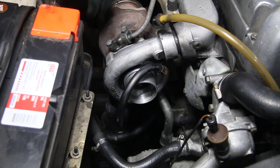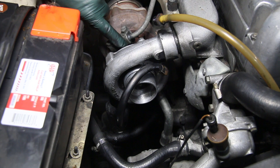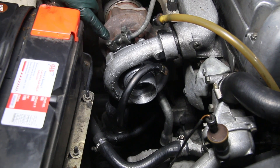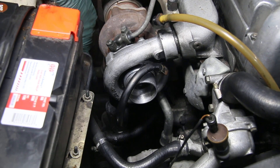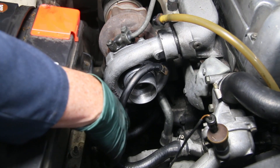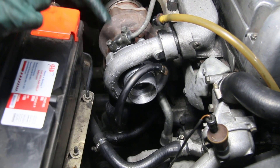Anytime you remove the air filter housing and intake elbow you want to look for potential oil leaks in and around the turbocharger. There are two areas. This here is the oil inlet to the turbocharger — there's a gasket right here and it looks pretty wet; it's just starting to leak. I've already made sure those two bolts are tight, so I'm going to need to replace this gasket. Down below you can see the oil wetness on the rubber motor mount, which has now deteriorated due to this minor oil leak. The other area is the oil outlet tube from the turbocharger going into the pan — it has seals that will harden and start to leak, usually giving dripping oil in that right front corner of the pan. This outlet looks okay, but I've got a little leak at the inlet to attend to.